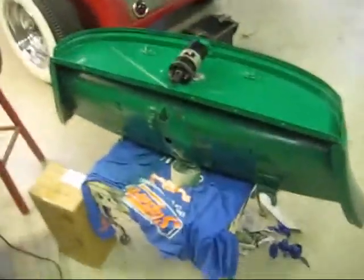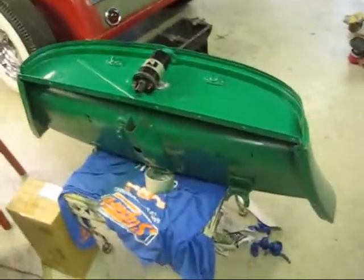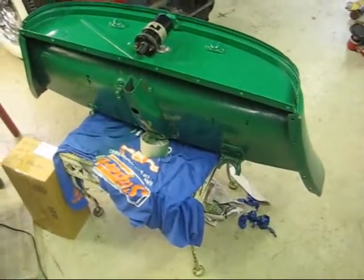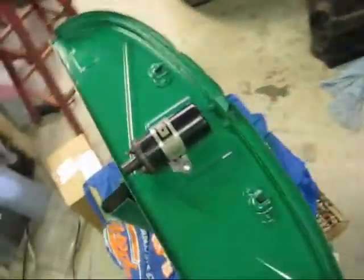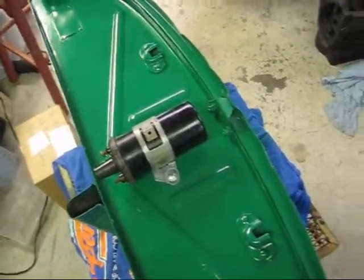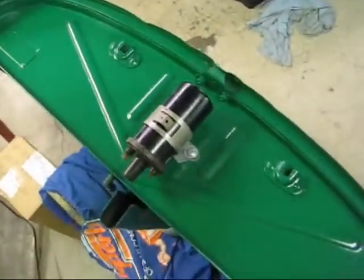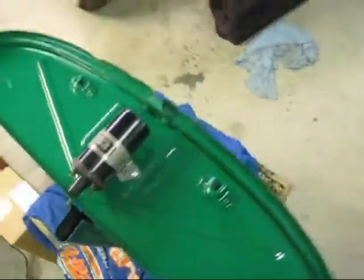The gas tank has got some holes in it, so I'll probably just run a little tank and a six-volt fuel pump until I can find a replacement. I found a coil bracket on an old 235 Chevy I had, and I'd worked on a guy's DeSoto to change it over to 12 volts, so I found a six-volt coil for this thing.